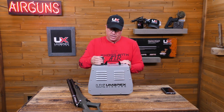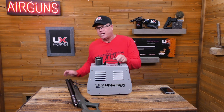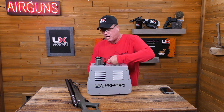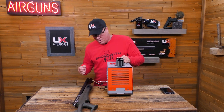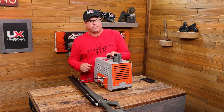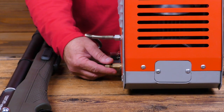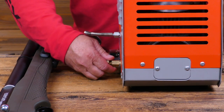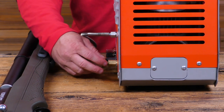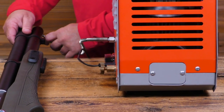What we have to do next to utilize this thing — and the only reason I'm doing it this way — is once it's done pumping, you can actually bleed it off. Because there's line pressure in here, if I tried to pull the adapter out it would pop the O-rings or it might whip you. So what you want to do is bleed this off first. I bleed off all the pressure and you'll see a little bit of moisture come out. Then tighten that back up and the probe should slide out nice and easy.